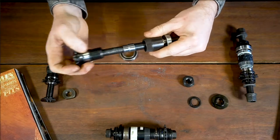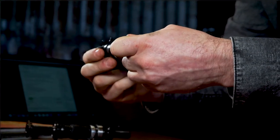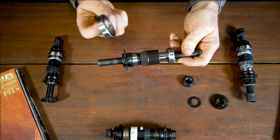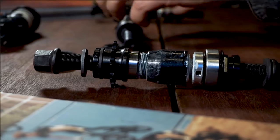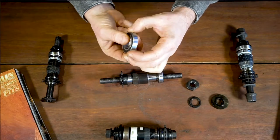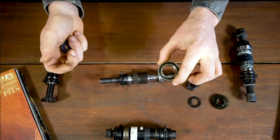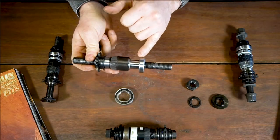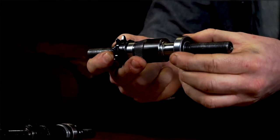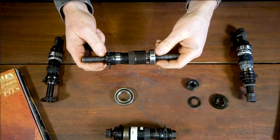Moving on from there, if you've created a nice platform where the driver can tighten up — you test the lock nut, tighten the driver onto the axle, the driver spins freely and doesn't have any play — the next thing you want to look at is the bearing on the drive side of the hub shell. Because this bearing is so heavily affected by these loads — as the clutch is pulling the driver in, it puts load on the inner part of the drive-side bearing — you can get play in these bearings. If you've got play in the hub, you'll be able to notice it there. Once that bearing starts to fail, you're putting all the load back into the non-drive side bearing, the only bearing relative from the axle to the hub shell, and you'll have play throughout the wheel. Those are all the things you need to check when isolating your bearings in the system for your hub shell.